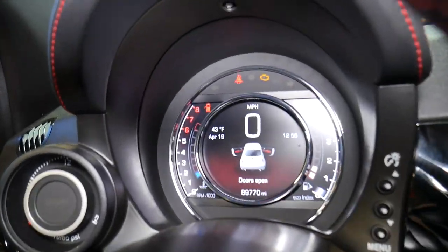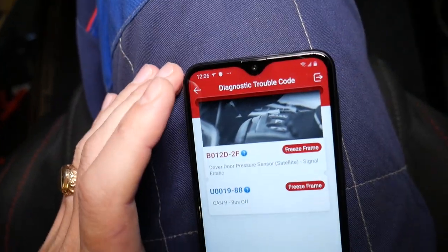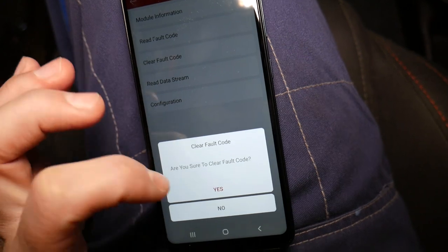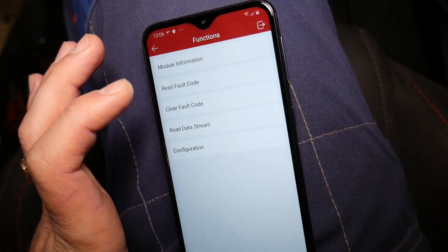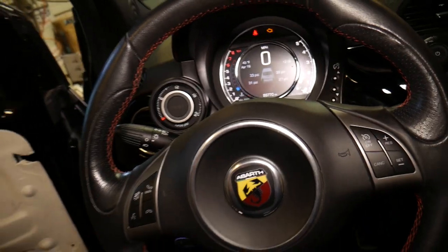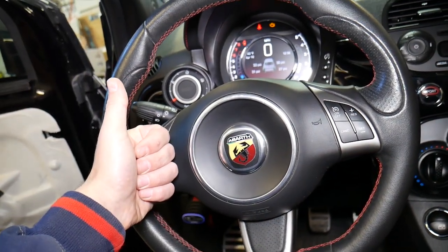Ours was just a loose connection — we reconnected it and connected the car battery back. Make sure that your safety pin is all the way in, because if it's not it can come loose and you may get that code if you hit a bump. We'll go ahead and turn the ignition back on. The airbag light should go off — check it out, it's not on now. We can click 'Go Back' and clear the fault codes. Clear fault code completed. If we read the codes now — no fault codes, everything is normal. That definitely took care of our problem. Hopefully the video will be helpful — thank you for watching and see you guys next time.